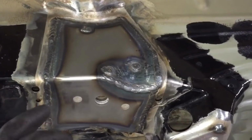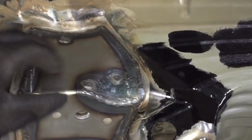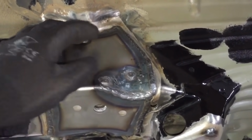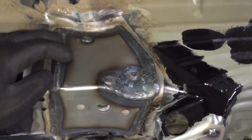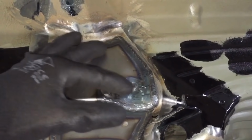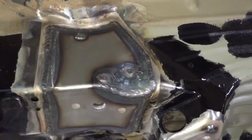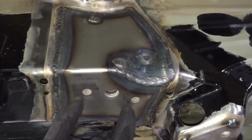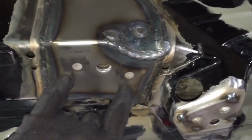So this plate is showing that once we've done our weld to actually attach the plate to the chassis, in these areas these other holes are for aiding the installation and curving of the plate to follow the contour of the floor. The bottom two are actually left so that the outer panel can be drilled out. So they're centre punched, waiting to be drilled.